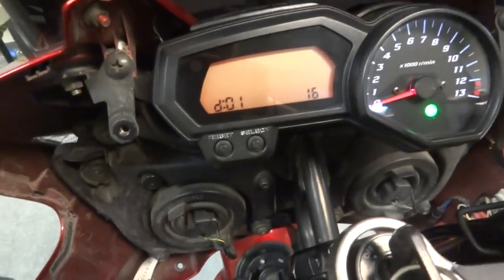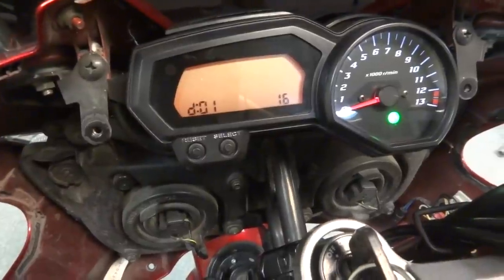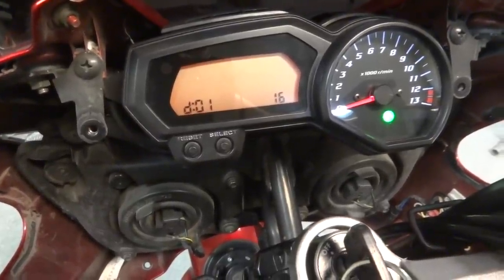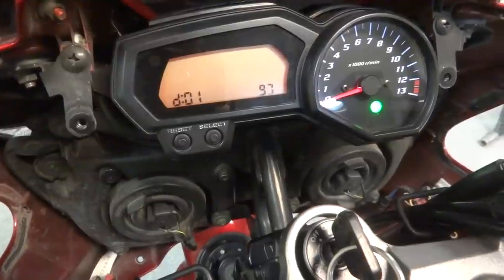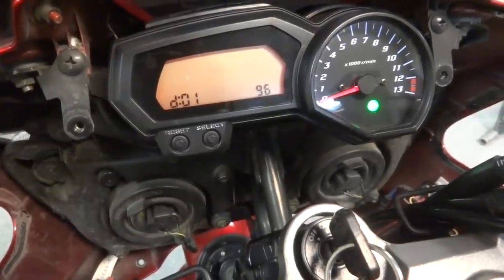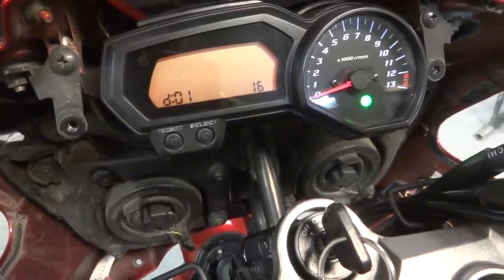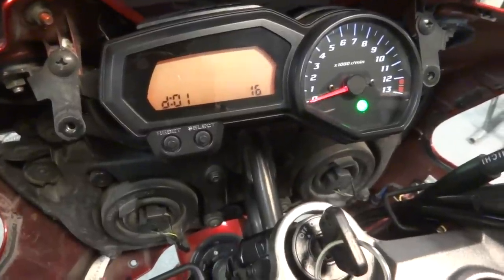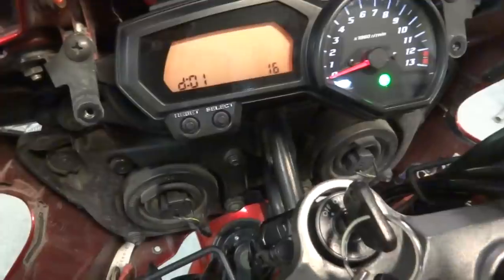So this is supposed to be between 15 and 18. I've been reading some forums and a lot of FZ1 owners seem to like it at 18. Mine max is about 96 or 97. I didn't see anything about a maximum specification. But when there's no pressure on the throttle — when you're not touching the throttle — it should be between 15 and 18, preferably 18.